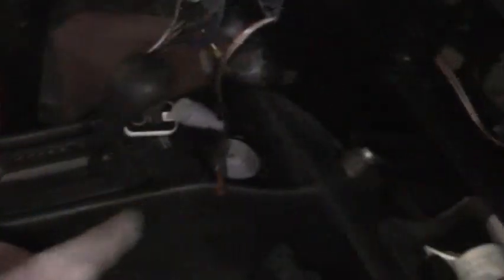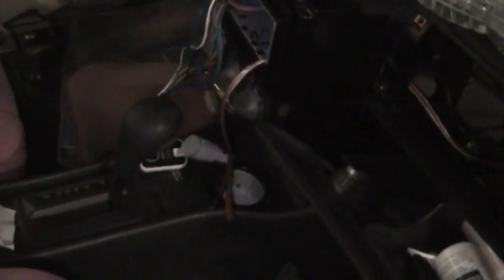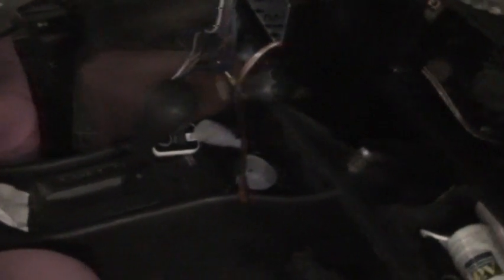Sorry for the poor lighting. Putting it in the car is the same as taking the old one out — just put it in, tighten those two bolts up there, hook up all the wiring to the back of the radio. The only extra wire we have: we've already connected the remote wire to the harness, and we've got a pair of RCAs because we are putting an amplifier in this. Then button up the dash the exact opposite way it came off. That's it. Please feel free to post any questions or comments, and as always, thanks for watching.